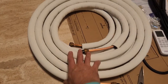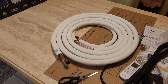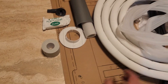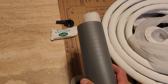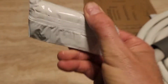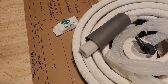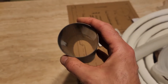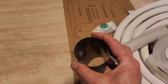It seems to have a really nice weather-resistant, attractive insulation around it. I may or may not use any of this included line set because I have flexible line set on order that I haven't received yet. Also in the condenser box is a drain hose to drain condensation water, so I'll have to cut another hole in the vehicle floor for drainage. There's also what I think is clay for something related to the drain, and a template showing the hole size — it looks like a couple inches, which seems very large.